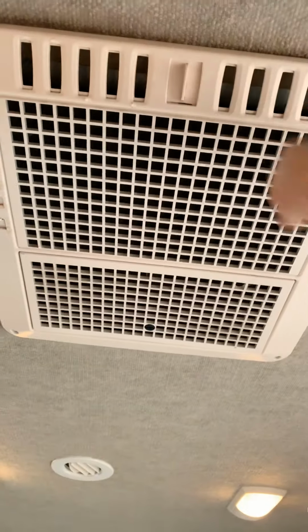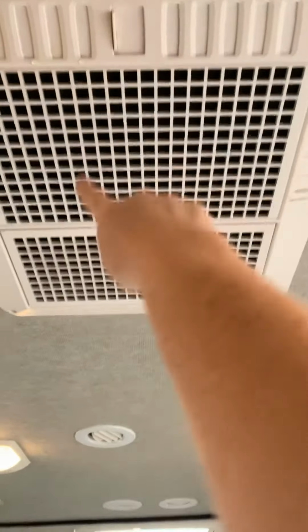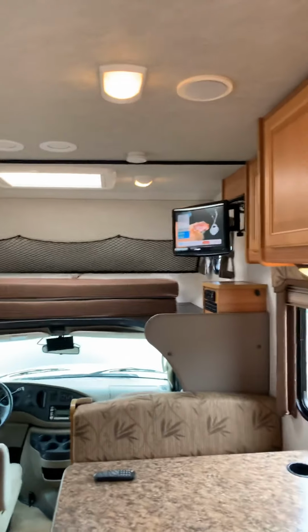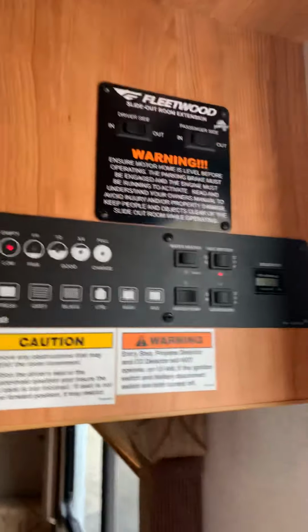This is called a chill grill. You can air dump cool air here or close it off. And behind this grill area, there are filters. They do gather dust over time, so it's recommended you clean those out, wash them or replace them once a season or once a year, depending how much you're running the air conditioner.